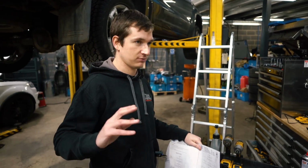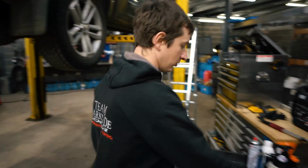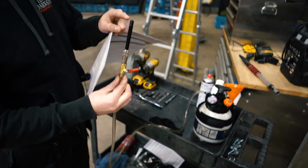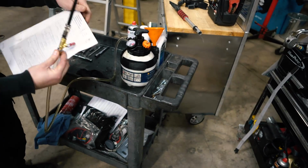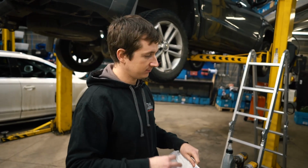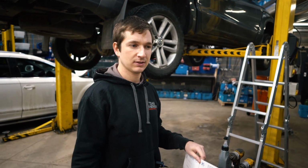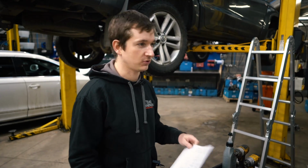And he sort of had a little bit of a change of tactic, and he said, let's just get it a bit warmer, and then we'll overfill it again. So instead of going in the side, we went into the drain bung with this and stuck the rest of that half a litre in, like it's saying here, overfill it by half a litre, and then we'll get it up to temperature again. We've put that half a litre in, got it up to, I think after 3.5 hours of ticking over, it got to like 60 something degrees. So we just said, it ain't gonna happen.